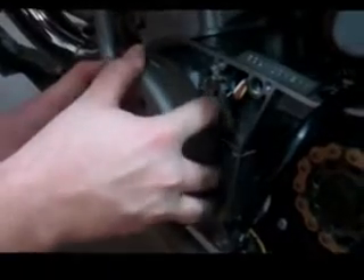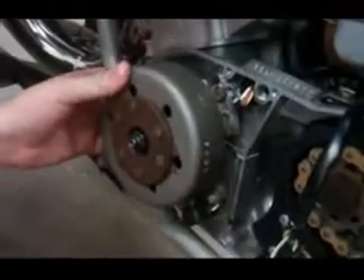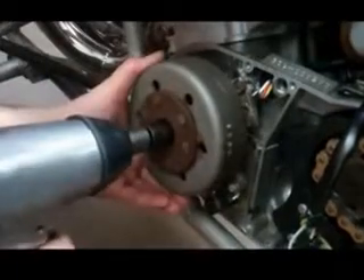Now we're going to reinstall our flywheel. Make sure you check where the notch is inside and line it up with the woodruff key. Now that we've got the crankshaft lined up and pressed on a little bit, use an impact wrench to tighten up the nut — a couple turns to make sure it's fully seated. Make sure there's no interference: the pickup coil can be slid back and forth just a little bit, and you want to make sure it lines up with the ridges on the flywheel and that the magnet is centered on them when it slides by. That confirms the flywheel is seated all the way. Then spin it by hand a little bit to make sure you don't hear any grinding or interference.